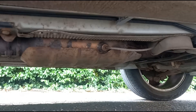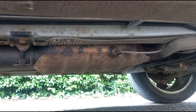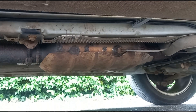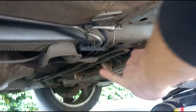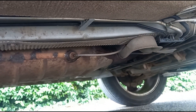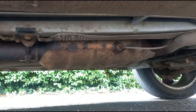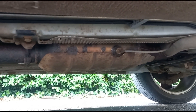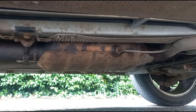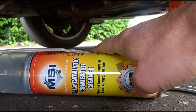If that doesn't work then we need to look at the vaporizer. The vaporizer is effectively a fifth injector on this car and they do fill up with carbon. You can burn them off just using a blowtorch and a bit of pressure, but we'll cover that if we have to — it's a real pain to get at, kind of up underneath there. Passive regeneration — that's when the heat of the exhaust alone is burning off the carbon — does produce some smoke. So I suspect it's probably the active regeneration that's the problem here, and a DPF full of ash, which this foam should help with.